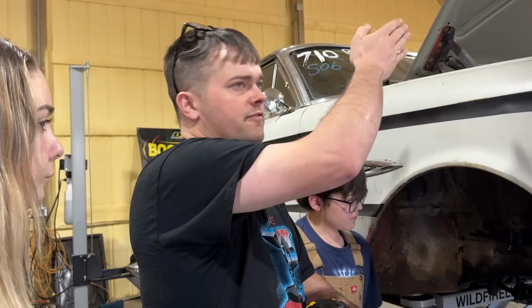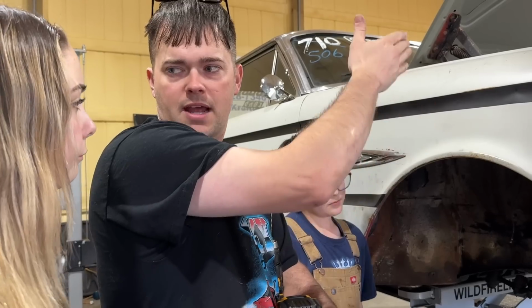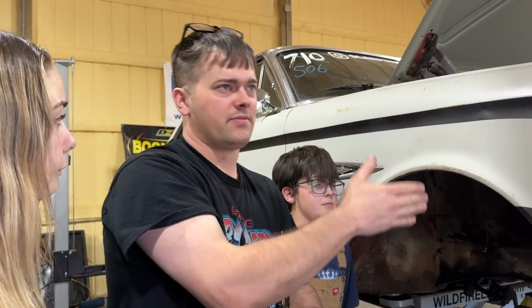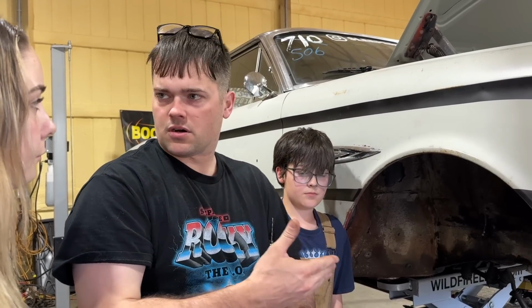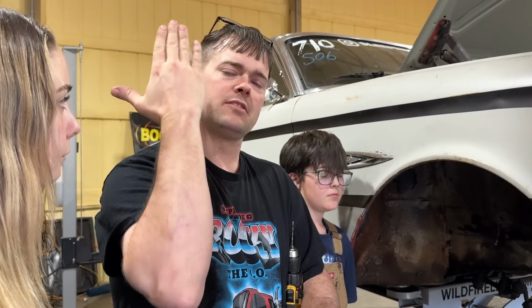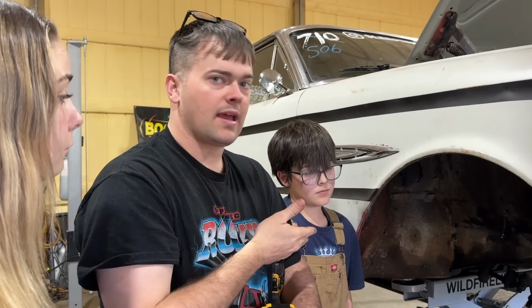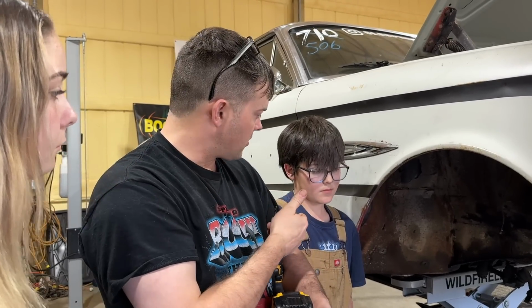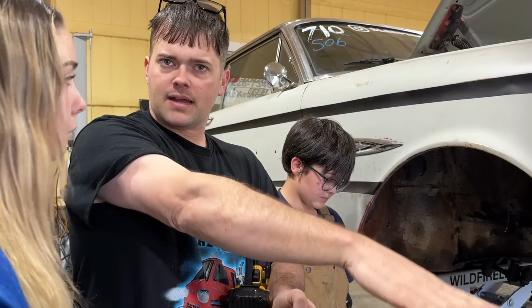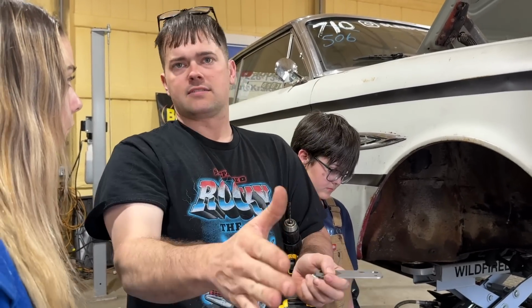I knew that this kit was going to change our suspension geometry, but I saw that the factory caster angle, which is the imaginary line between your upper and lower ball joint, is 0 degrees on this. Basically, if you have 0 degrees, it feels like you're on a bowling ball and the car just kind of wanders on the road a lot. A lot of sports cars, high-end cars, they lay that angle back. So this kit moves it from 0 degrees back to 7 degrees. But you remember we did that with the Metromite, we did it with the Starlet as well. Yeah. The more you can lay that angle back, it's kind of like the rake on a bicycle. The farther out it is, the more it goes back to center when you let go of the wheel.